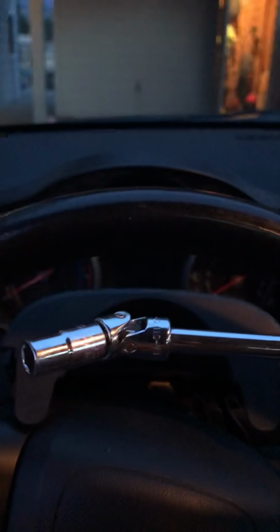Now there are, I believe, 5 screws holding this down on the top, and you have to pull this up. I just used a hand nut driver with a swivel end and a 7mm socket. They're not overly tight. It's very easily doable with just this setup. You don't need a ratchet or anything like that. But anyway, you get your screws out, two in the bottom, each side of the steering column. They're hard to get to, but you can see them. And the ones up here.